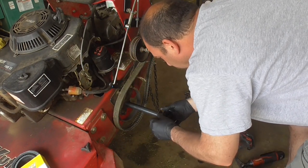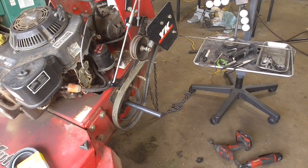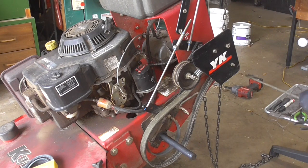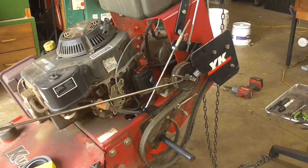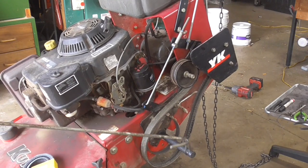This has a washer that stays on the inside, so I'll put that back. Next step, we're going to detension that spring. You've got to be careful with these springs — they're always under high tension. I have this rod that I use for pulling the springs and an S-clip. I'm going to hook that on the spring and give it a little pull. Now we safely have the spring loose.